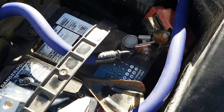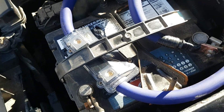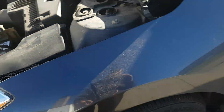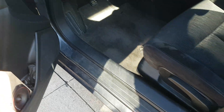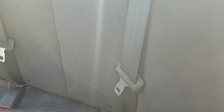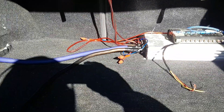I just finished all the wiring, put a new lug on there — zero gauge all the way into this. It's all waterproof. I only have a 120 amp fuse in there right now, even though I have a bigger system going in. The panels are all nicely tucked back in, still flush with all the carpet and trim. I ran it up and behind — noticed the gap where you can run it behind the steel structure instead of up and around — then ran it directly to the amp.